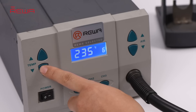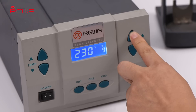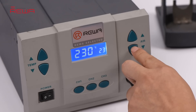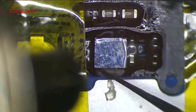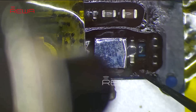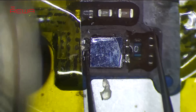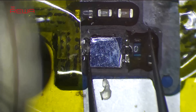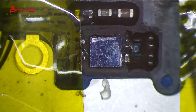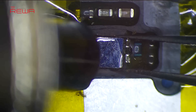Tips: the home button cable is fragile. Please control the operating temperature of the hot air gun and the soldering iron during the repair work — this is to protect the home button cable from high temperature damage. Heat with the hot air gun to remove sealing adhesive around the U10 chip, then detach the U10 chip from the home button cable.